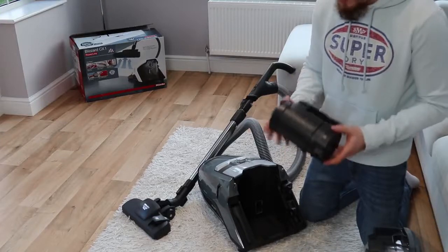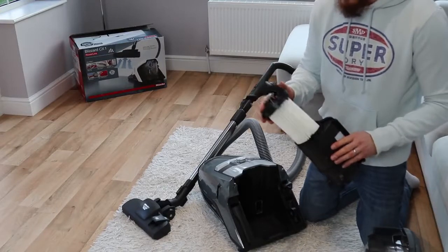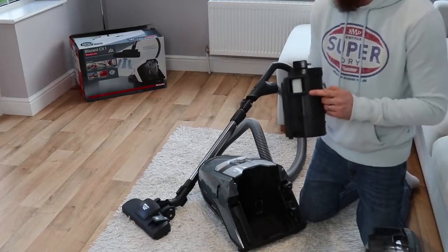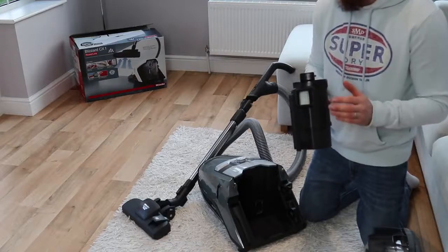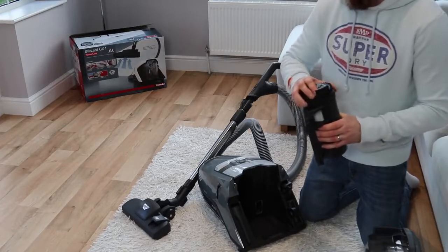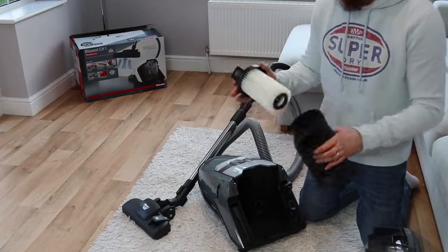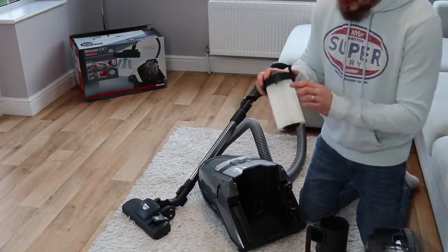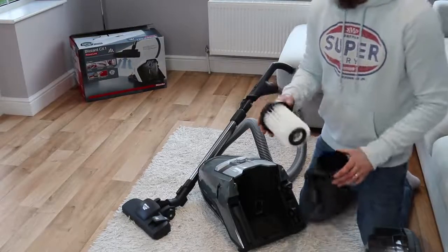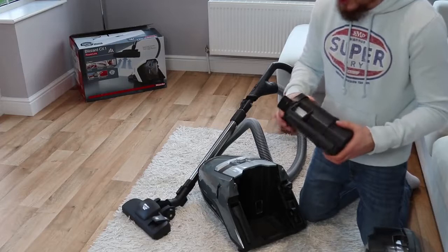When it comes to cleaning the filter, it's very simple - the instructions are printed on the filter itself. All we do is turn the handle and it comes straight out. Before turning the cog, the best thing to do is run some water into the hole here to minimise the dirt that comes off when you open it. Give it a swirl, then open it over a sink to empty the contents. Run warm water across all the fibres to make sure it's fully clean. These filters are replaceable, but Miele has made them cleanable so you can manually clean them yourself and extend the lifetime of the filtration system.